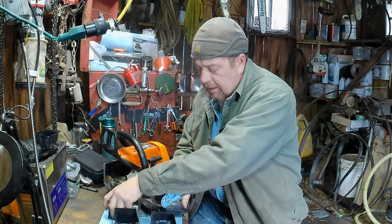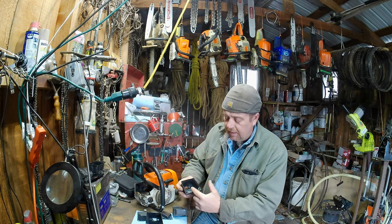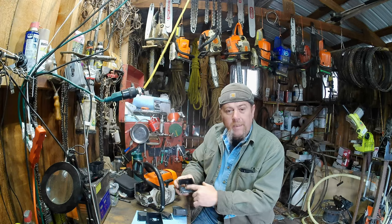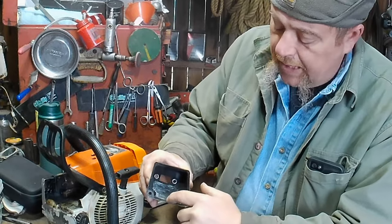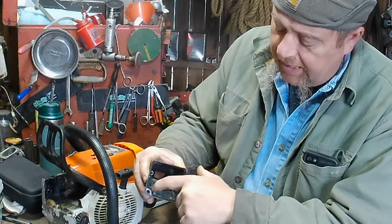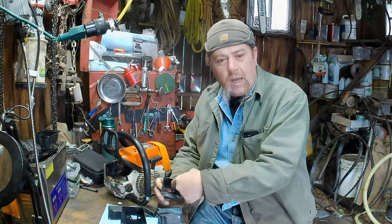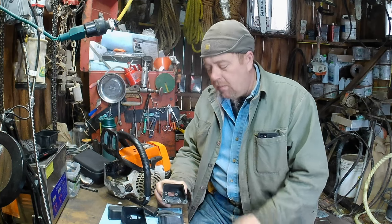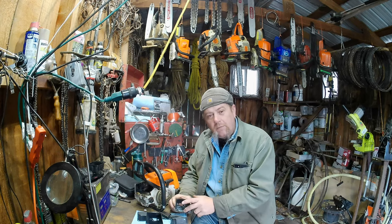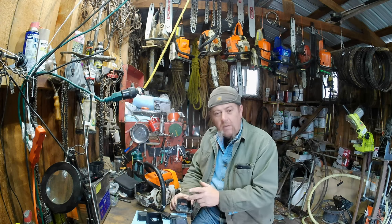What we're going to do today is test these three lids that we've tested before on a new can. Today we're testing for reduced volume in this can. I've welded a flat plate that basically goes from the exhaust port out to the lip — it's not protruding from the lip so the lids can still seal on there. It takes up the space the best I can; it's not perfect. In one corner it can get a little air under it, but I think it's going to do what we want. The baffle heat results were just surprising — the stock baffle in there shocked me. I don't know if that's a reduction in volume or how it's affecting airflow. So today we're working with reduced volume on two cans, running these three lids.